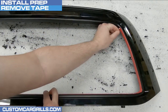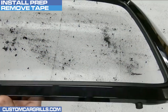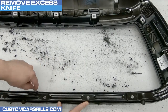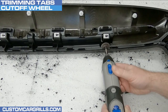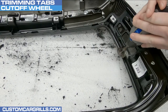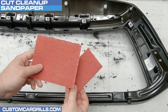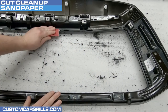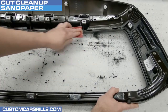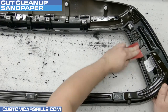For anyone not familiar with using a Dremel this way, the large center plastic section that was removed earlier can be used for practice. The tape guide can be removed and discarded once the plastic is trimmed to the tape edge. Then I'm going to make sure the edges look good before moving on to shaving some of the burnt bits with a knife. I'll also be trimming back some of the plastic near the screw clips as well as the couple large tabs near the top center and on each side. For the final smoothing, I'll be using various sandpapers — typically starting with 100 grit and then working down to 300 or 400 to get a smooth edge. It's important to be careful not to slip and scuff the edge that will be seen.